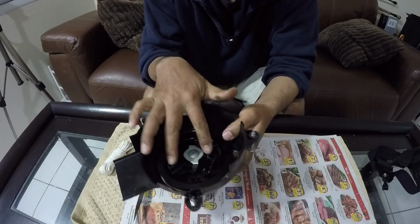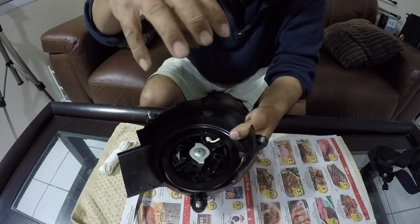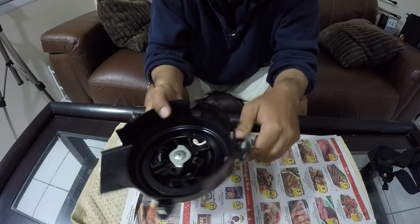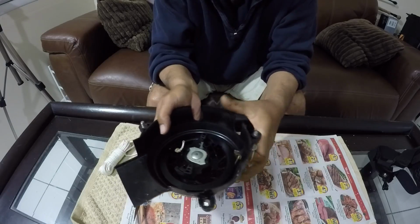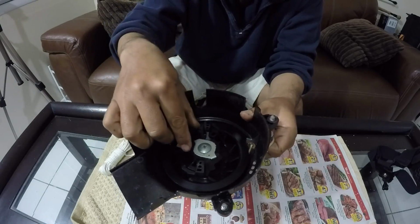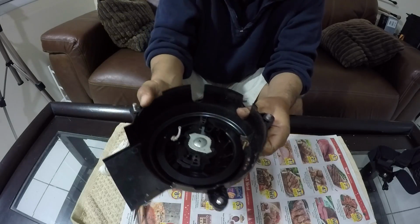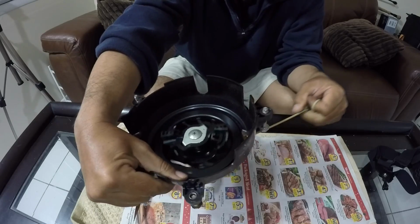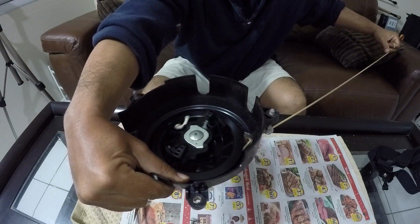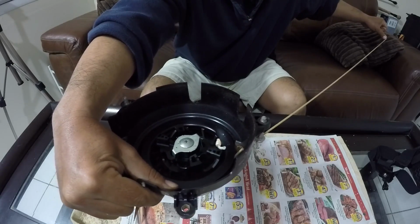This has kind of a clutch system where these plastic pieces engage the actual crankshaft, the motor, and the crank. And then as you pull on it, you can see how these parts raise. When you put the tension on it, the springs push it up. It interlocks with teeth on the actual motor. So when you're pulling this, as you're starting it, this is what turns your motor and gets it going and starts the spark and hits the piston and gets the motor running.